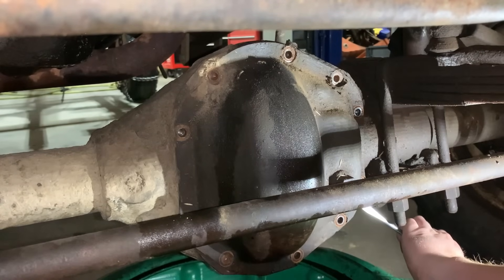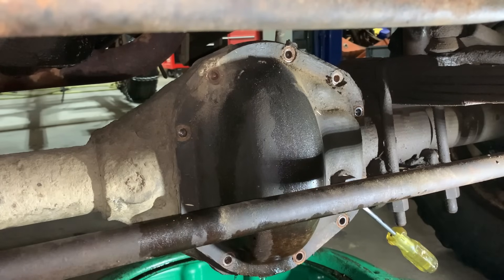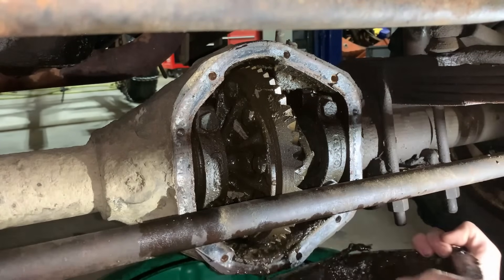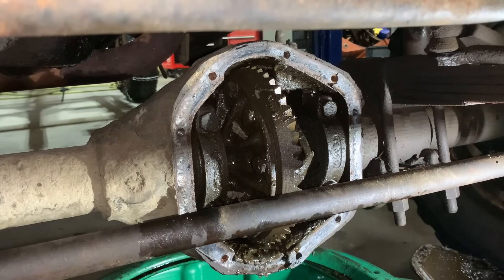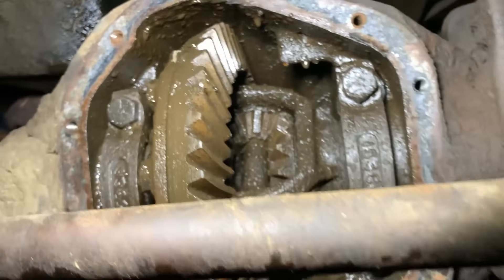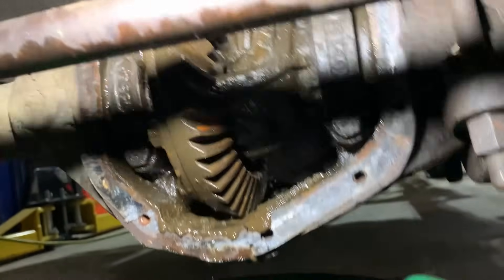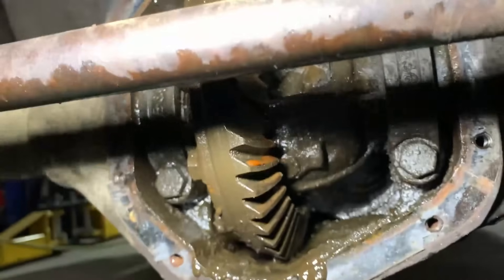Let's see what kind of nightmare we can unfold. That's a lot of water in there — that's neat. It's like I never checked any of the fluids in this truck since I've owned it. Maybe that's why it blew up. I would have fully expected the spider gears to be blown apart into a million pieces and rolling around in here binding things up. But surprisingly, everything appears to be intact — there's not any broken teeth that I can see. Of course we'll grab the yoke and try to spin it around and see what else we can discover. I would have expected a lot more carnage in here than this.